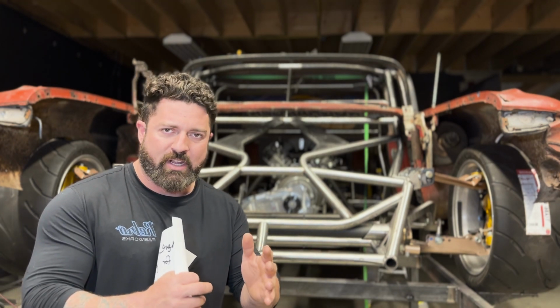So the whole idea is, and I'll break it down, the SCS gearbox goes to carbon shafts. I'm using my Ford 9-inch Currie center sections, carbon shafts, and I'm going to have a very special piece that I told you guys before that's going to differentiate and actually make it all-wheel drive.